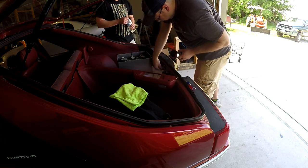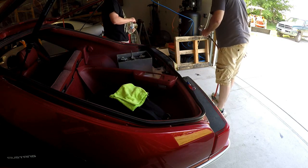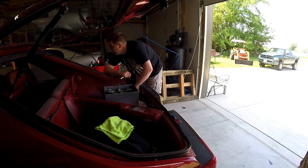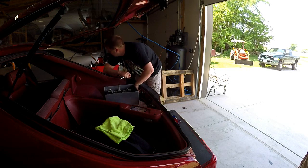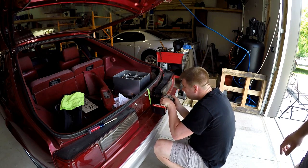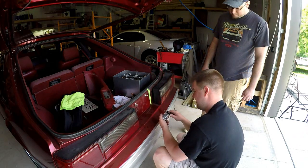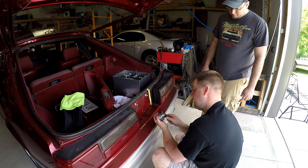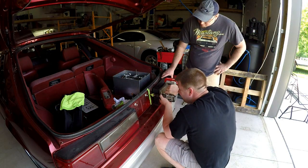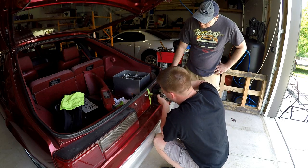There are actually only three points you need to cut in order to remove that piece of metal, and you can see I'm just wiggling it back and forth to break it away from the car. We also loosened the bolts from the tail light housing and moved it out of the way to make it easier to drill our pilot hole. What I used to mark the pilot hole was the ring marked on and off — I traced a circle inside it and put the knob on the outside to verify it won't interfere with the license plate or tail light housing. We centered up the hole, drilled the pilot hole with a smaller drill bit, then used the step-up bit — we went up to the three-quarter option and it worked out just fine.